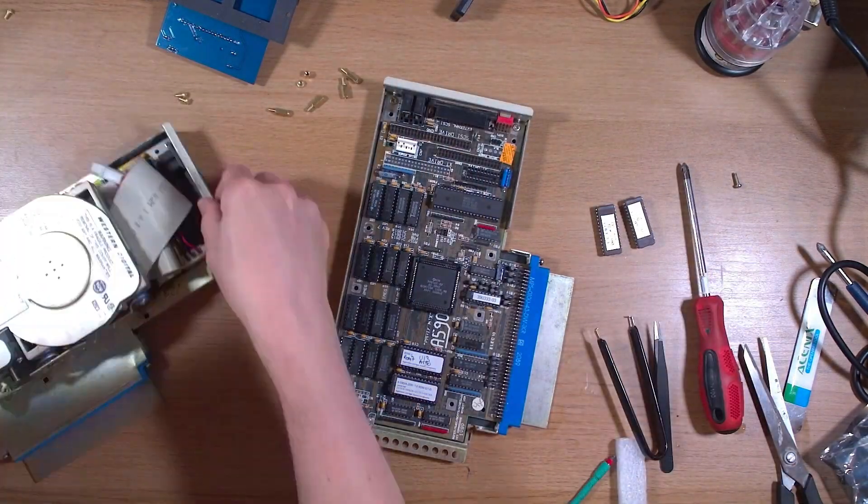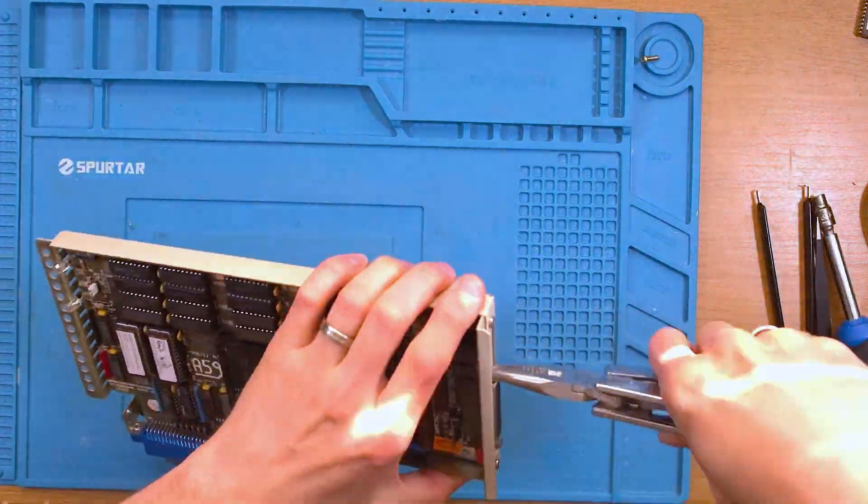This means I just need to make the mod to the other A590 to work with the DMACC version 2, along with putting the V7 ROMs in. I wonder if the original Epson hard disks did have the XT connector on the other side — it would have made sense based on the design they changed to later on. Also, with the V4.4 ROMs reinstalled, it wouldn't recognise the XT hard disk properly, so either they're actually faulty or the original 4.4 ROMs only worked with that original Epson hard disk drive. I had to put the V4.6 ROMs in to make it actually boot. I also discovered that despite the claims, the V7 ROMs do actually successfully work with XT drives.